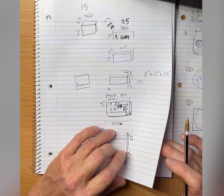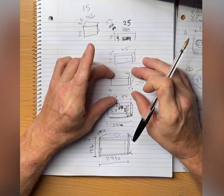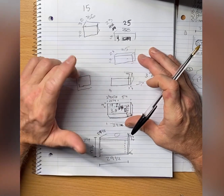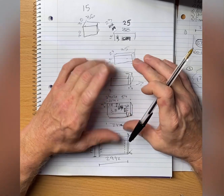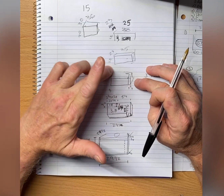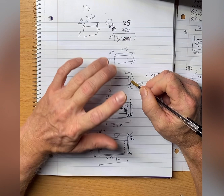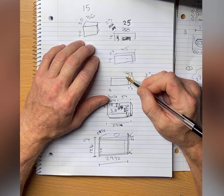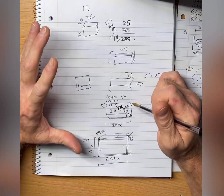Thinking about the placement of this, you can actually go into the port calculator and change the height of the port. As you change the port height, it changes the length. Keep your chamber the same, because that's not going to be different ever. We're going to keep 4 cubes. But as you change the height of that port, which is changing the height of the box, it increases or decreases the port. So the key to it, and the secret in my view, is this. You want to make that to where that port goes in and turns one time. I've had to do otherwise, and it'll still work, but I like this chambered feel.